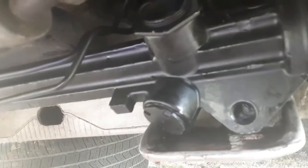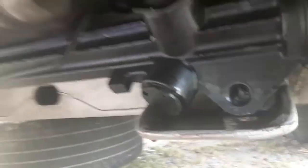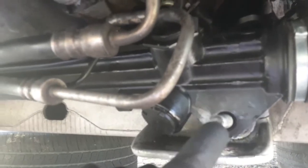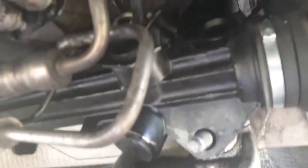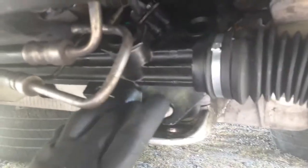We're going to connect our lines back in here and you can move this side around. Got my lines back hooked up right here — two lines — and the steering right here. Your steering bolt on your steering column. The best way to do that is to keep your pins out — keep these pins out, keep this one out and this one out — until you get your lines tightened down and your steering column on right up here. Tighten that down and then you can put your pins back in.